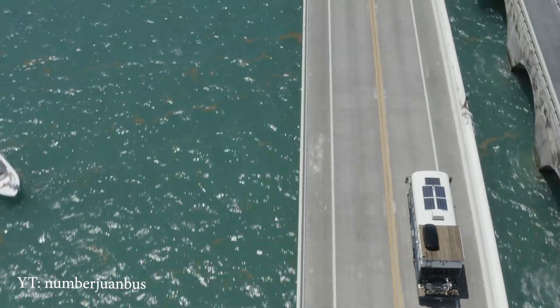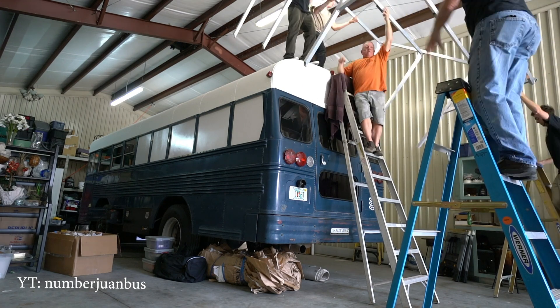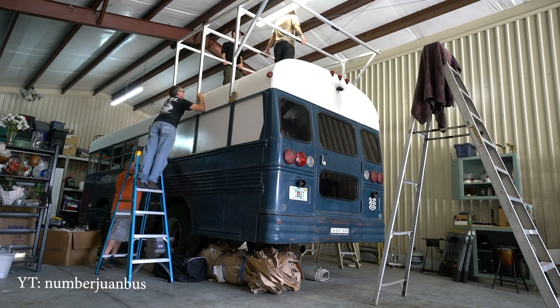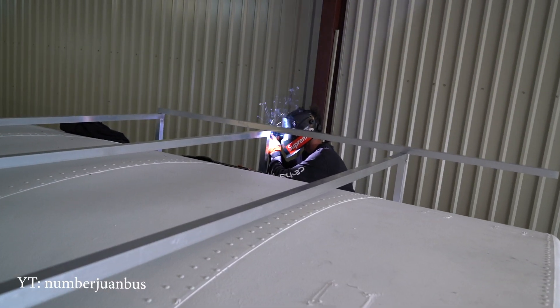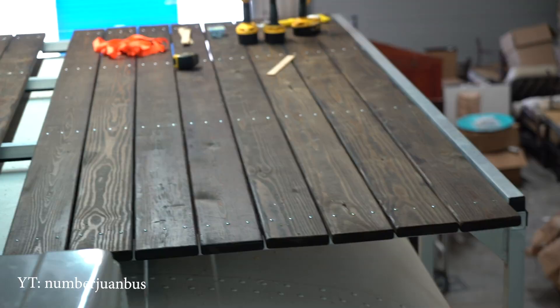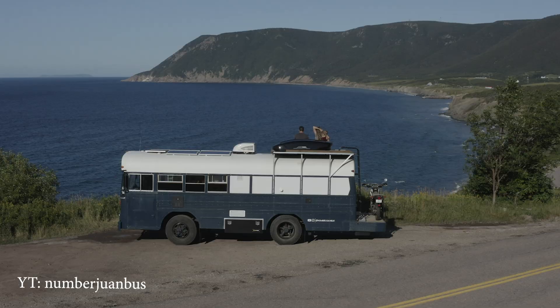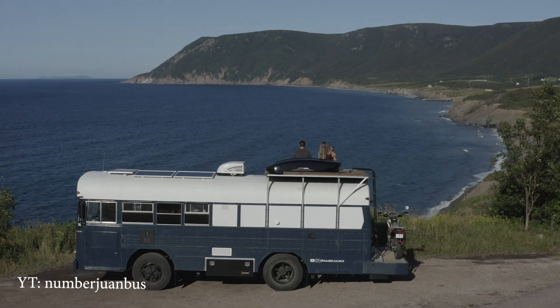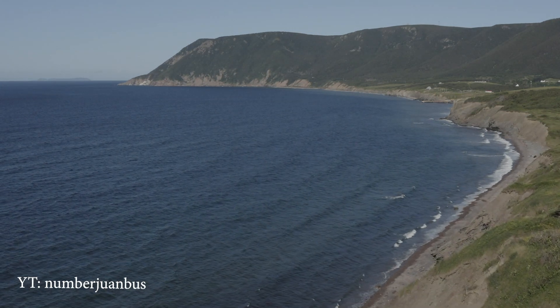In the case of the Number One Bus, my friend Will built a deck that slid over the bus with side rails that went down the sides. This can also be a good option because he bolted through the side channels of the bus and used the existing structure to create strength. The only issue is that all the weight relies on about eight bolts hanging on the side. What Will did to prevent problems is that the top of his deck actually rests on the bus, so the sides aren't taking all the force — they're simply keeping it from sliding forward and backward.